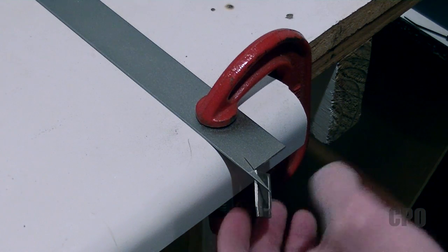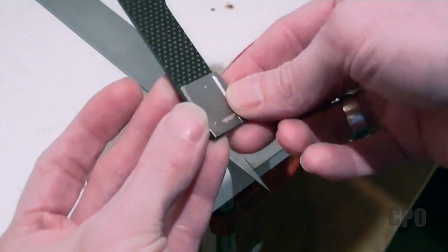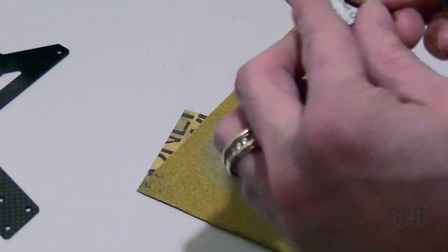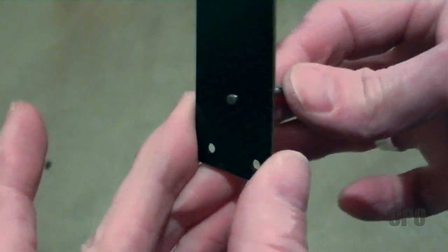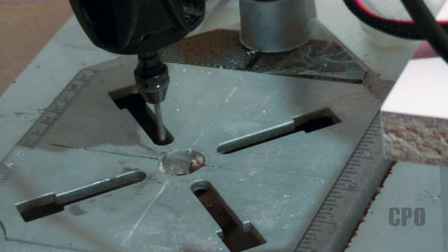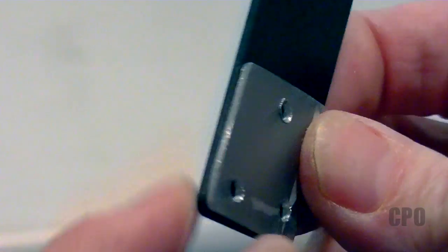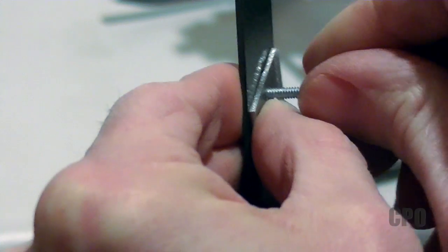Ouch! It's a little hot, so pliers are in order. Here's how it fits now that it's cut. I'm using sandpaper to sand down all the rough edges. I used a 3 millimeter drill bit, which is the exact size of the holes in the frame side, and I used a little Dremel press to drill the three holes in the aluminum. They line up nice and straight, and that's important. You can see here the aluminum is the same thickness as the carbon fiber.